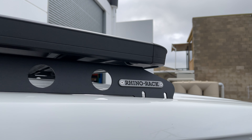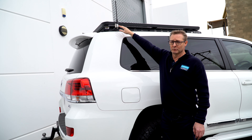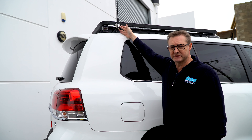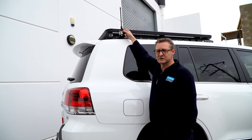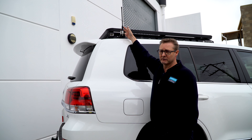We also fitted the Rhino rack for this particular build — it's a very popular product, well engineered, good fit and good price. We can also fit side lights and a UHF antenna here where you don't want it on the bull bar for everyday use. It's a 3 dB antenna, good for medium distance or hilly country, more so than the deserts where you might fit an antenna on the front instead.